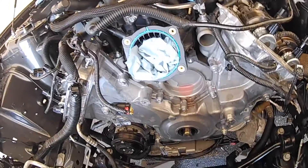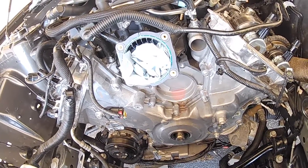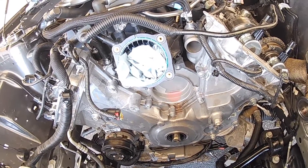Alright guys, we got the crank pulley off. After some technical difficulties — the tool from AutoZone kind of sucked, definitely garbage — but we got it off. We are going to remove the timing cover and get to work. I'm not really going to record much of it; I want to focus on not screwing anything up. I got the timing cover off — it's 13s and 10s. Remember to take off the four bolts on the bottom that hold the oil pan and the timing cover together.